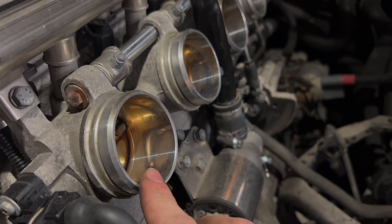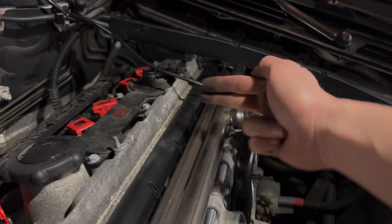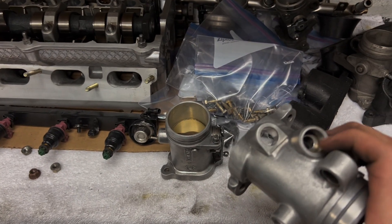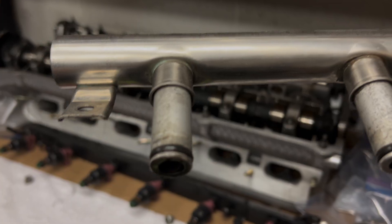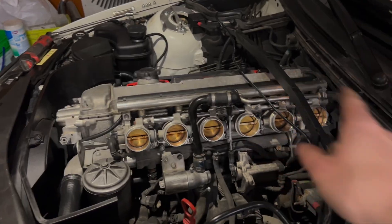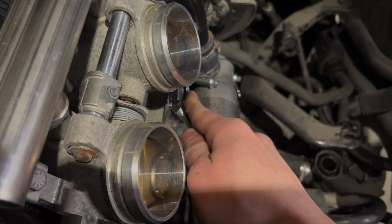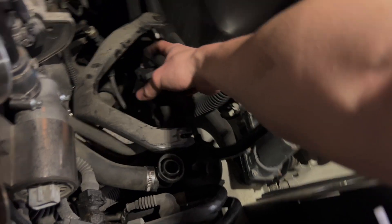This car has a vacuum manifold because it has ITBs. It's not an intake manifold because it doesn't hold vacuum — it's an intake plenum, that's where the throttle bodies are. Behind that there's vacuum in each individual little chamber. These ports — one is for the fuel injector, one is the vacuum port going into the vacuum manifold — run down to every cylinder. That collects all the vacuum out of every throttle body, brings it to the brake booster, and there's a small T-off for the vacuum line going to the fuel pressure regulator.